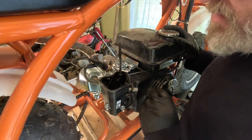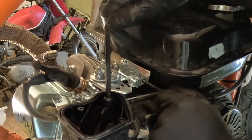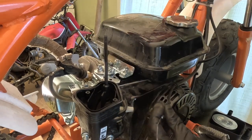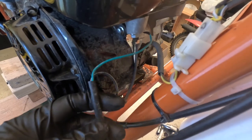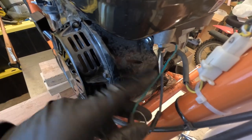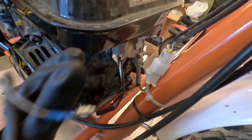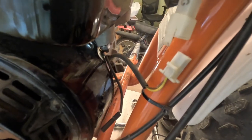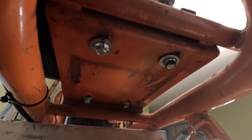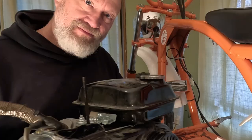It's going to be this cable, one screw here and that screw there that holds it. On the front of the engine is the kill switch — I need to disconnect that nut with the ground and it'll come right off. Kill switch wires are disconnected, and the only thing left is to disconnect the connector for the headlight — that just pops out. Now the only thing left is to undo those four bolts and the engine will just lift right out. Bolts are undone — as easy as that.